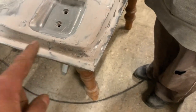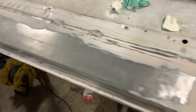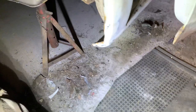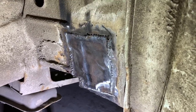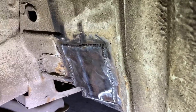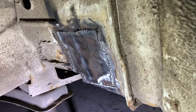I just lost my finger — I didn't realise it locked the end of the glove. So round there she's just going to put a bit of filler in now so she can sand it next time she comes. Then that can have some primer on because it hasn't got to be that good. You don't really see that part at all, and up there you see a bit, but none of this you see because it's all hidden when you're under the door. We're making good progress with the door — I want to get that back on by the weekend. That's gone in there and it's pretty good — really nice and solid. So that's all done. I'm going to put some seam seal around that now, and not bother grinding it back anymore. Seam seal and then a bit of under seal next time we come up.